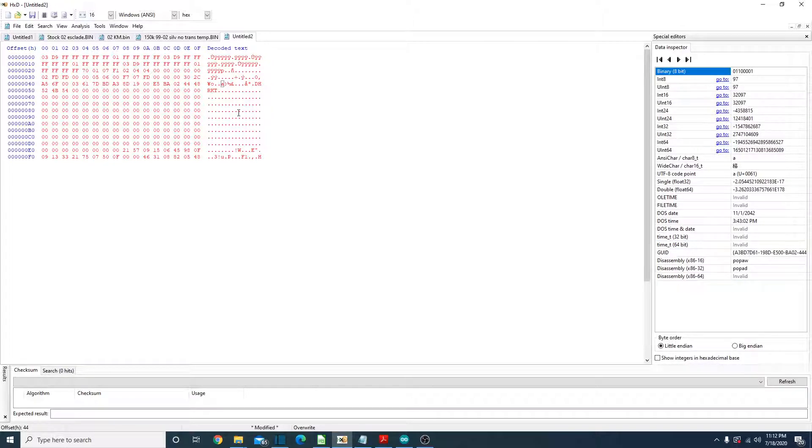I'm going to make an adjustment here and then show you on camera. The byte I just changed controls whether it shows the odometer or the trip when it boots up. That 0x01 meant it was going to show the odometer on boot. Let's switch the camera over so you can see I'm not lying, then we'll flash what we had and make that change.